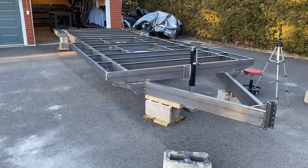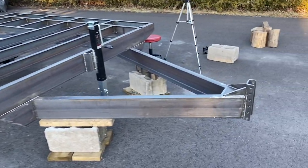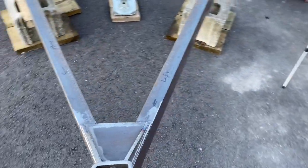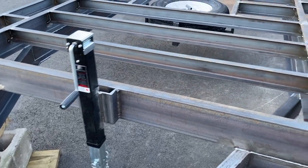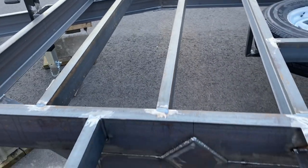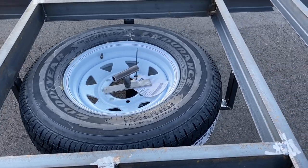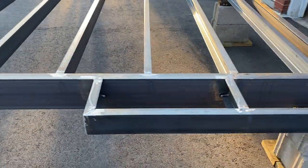The platform is pretty much done — I spent about eight hours welding it all together today. Perfect weather for welding: not too hot, so I wasn't sweating. I also added quite a bit of braces, and the jack and cross members are all welded. The cross members at four inches are fish-plated to the double frame. I also built a spare tire carrier today — it's going to be recessed in the floor. The other hole is for the water tank. I'm ready to start welding the axles in position next week.